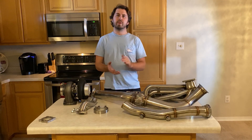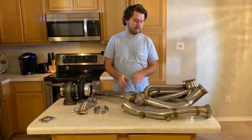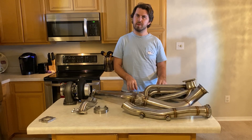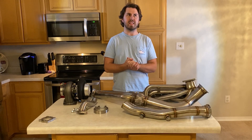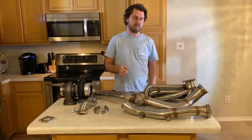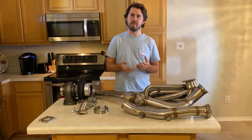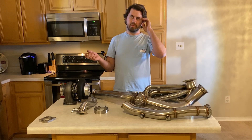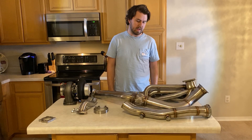I will do a full install video on the manifold, but I want to touch on the exhaust manifold studs. You can purchase really good ones from BMW — they're E7 Torx style so you can just screw them in with an E Torx socket, which makes removal and install very easy if you ever need to pull a stud. They're not really prone to seizing, and if you have an M54 like me, it's an aluminum head so you're really not going to have too big of an issue with that.